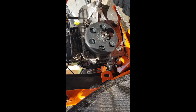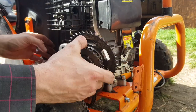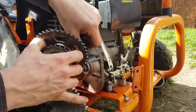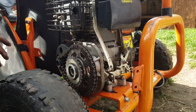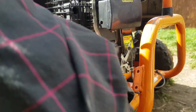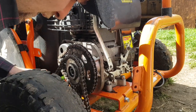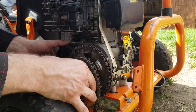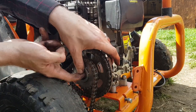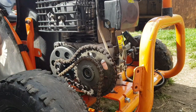This one might be a bit tricky and I might get in your way, but we'll stick the chain on and dangle it up the back. The other shaft is pretty much on and in place, but we don't want it fully there because we need this bottom chain on the bottom sprocket to come up and over. We need to be careful it's aligned with the chain sprocket before we tweak it back over. Oh yeah, the centre ring — there we go, and we are back on track. The chains are on now, a little bit of fiddling, but please remember the clip in the middle — the retainer ring — or else you'll be smacking that on there wondering why it's not working.